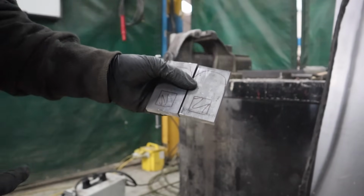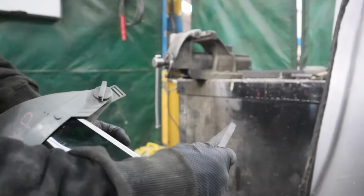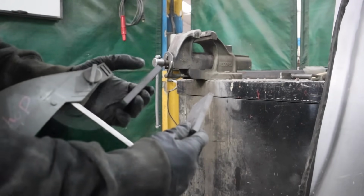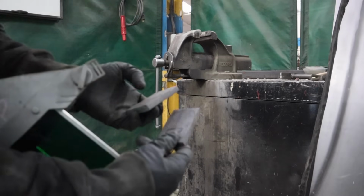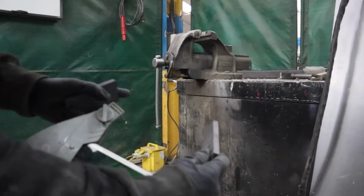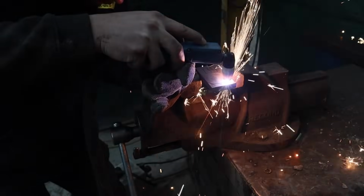So these are going to be our two engine mount brackets, which we're going to cut there. Dan's going to cut with a plasma cutter, and then they're going to slide over the metal bar, and that's going to be our lower engine mount. So we're obviously going to put two holes through here. That's going to be welded to the bar, and then the engine's going to sit between two of these, long bolt all the way through, and then that's our bottom engine mount done.